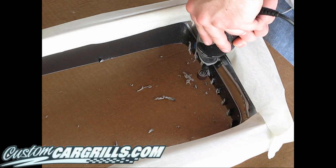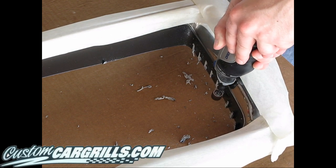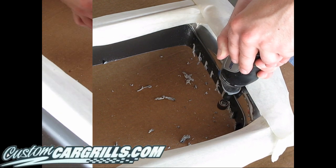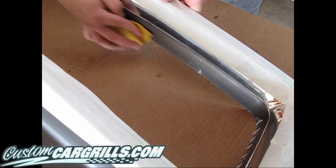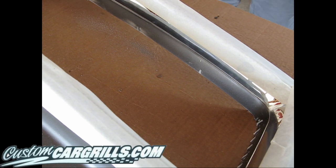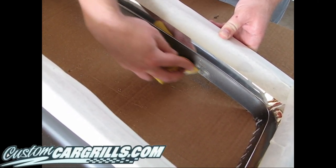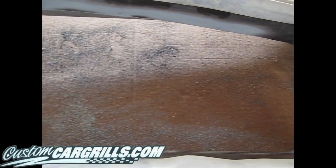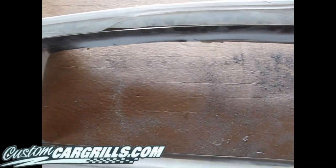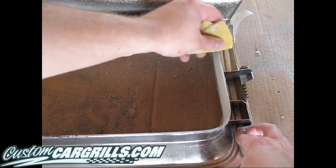You don't want to get them too far down — you don't want to have to fill in the side. Kind of use your best judgment when you're sanding these down so that you don't leave too much and you don't go too far. After we're done sanding with the Dremel, you're going to want to get some sandpaper of varying grits and put the finishing touch on the existing bar remains. This is by far going to be the most lengthy step you'll encounter. It's going to take quite a bit of time to sand these down so it's a nice smooth finish once it's actually painted, and that's going to be the key to make this thing look great. You may also need to sand the back of the grill if there are any grill remains back there — once this is painted, you want it to look like a nice even line, not wavy.